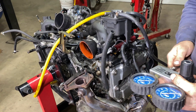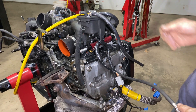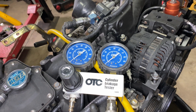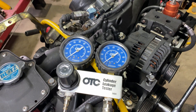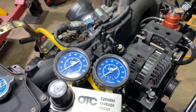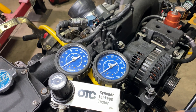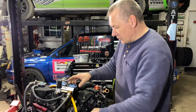I have to make sure the cylinder is at the very top. You have two ways of doing this: you can go with a camera through and rotate until the piston comes to the very top. I'm going to use a 22mm socket with the extension on the front shaft to rotate the engine — make sure you always rotate clockwise. What's going to happen is when we go on the compression stroke you are going to see the gauge going up, it's the piston going up and pushing and creating pressure in the hose. I'm going to go up until the needle stops moving — that's the top of the compression stroke. Now I know my piston is at the very top. I'm going to take my hose here.